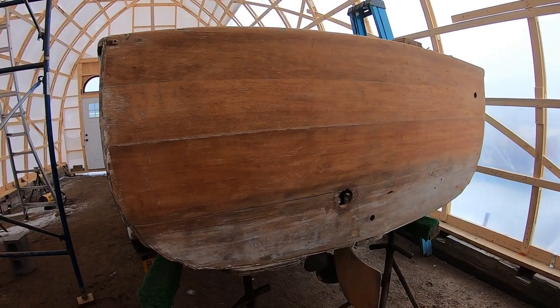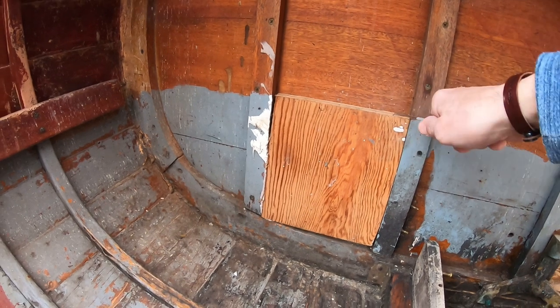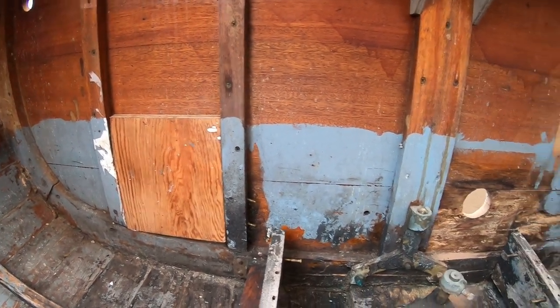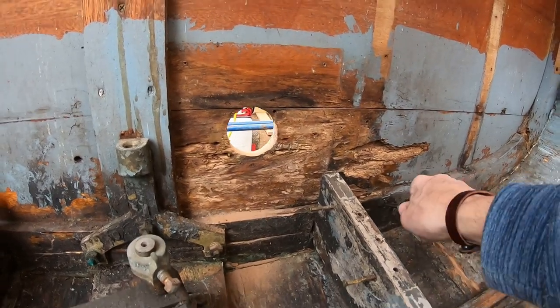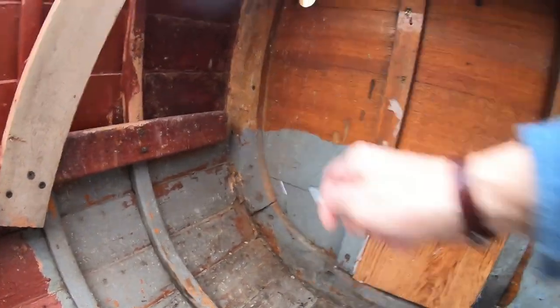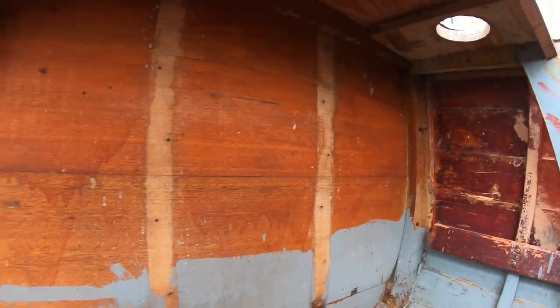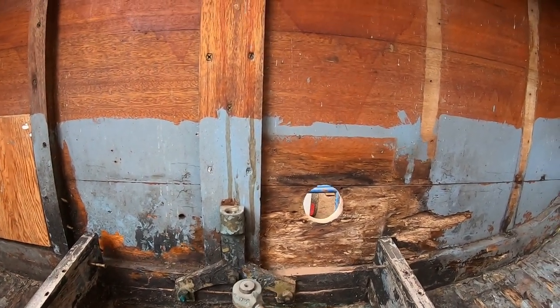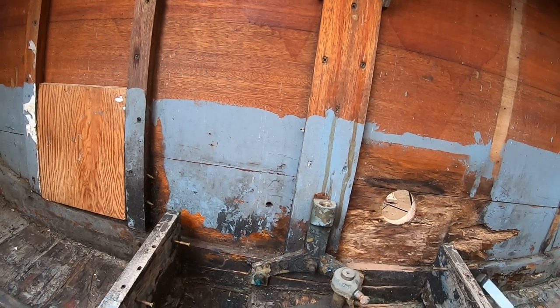Other than that, the transom is not too bad. Let's look inside and see what we see. Inside's telling us another story. This is where the sheetrock screws were. Here's a piece of plywood that's kind of shoring up something that's probably not going to be too good. Right here is obviously really bad — this is right where that support board comes down, which probably traps a lot of water. The white oak below it has some rot in it too, so that's probably going to need to be replaced on this side. Over here there's obvious rot, but it's good when you go up a little bit. We're going to need to replace probably this whole board, and we'll see once we get under here — probably replace the whole board.